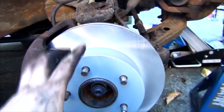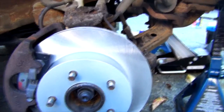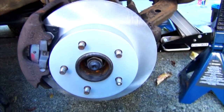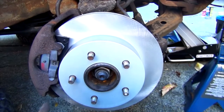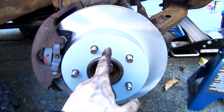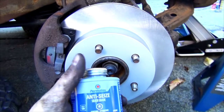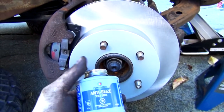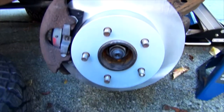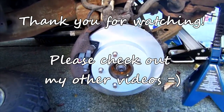If your tire isn't coming off easily, just give it a few quick heaves on the top — some people call it the 'butt hit': use your bum and hit it on top and it'll probably come off. On older late-90s Hondas with four lugs, the tire tends to get stuck. All you have to do is add a tiny bit of anti-seize — just a tiny dot, like a pimple — where it's sticking, and you won't have that problem anymore. Thanks for watching, if you have any questions please ask. Ciao!